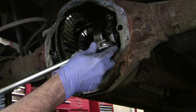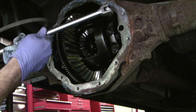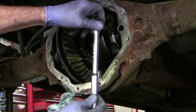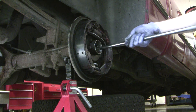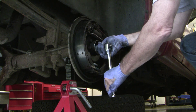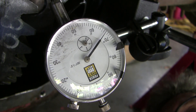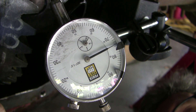To allow the adjusting screws to push the differential to the right side, we need to loosen the four cap bolts that hold the diff in place and loosen the locking tabs on both sides. When you loosen these cap bolts the diff shifts back and your backlash will instantly increase, so before taking any repeat measurements you need to retighten. The torque spec on those axle cap bolts is 100 foot-pounds. If I start by trying to screw in the left adjuster I won't be able to turn it very far because the right adjuster won't allow the diff to move right. So first give the diff a place to move by turning the right side a quarter turn out, then turn the left a quarter turn in. When you think you're close, retighten the cap bolts, measure your backlash again, and try again — this can take several attempts. At the end, the torque spec on both adjusting screws is 75 foot-pounds done with cap bolts loose, then you finally torque the cap bolts down and double-check your numbers.